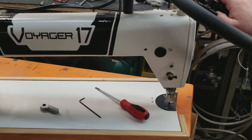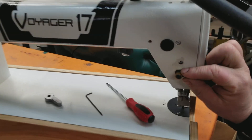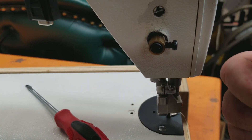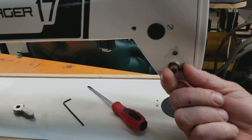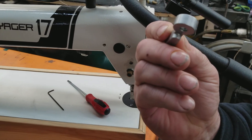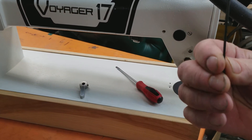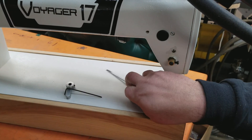In this video we're going to change out the presser foot lever. This one had a plastic lever on it and apparently the plastic has broken off. To change to the new aluminum presser foot you only need a couple tools: a 5/64th allen wrench and a regular screwdriver.